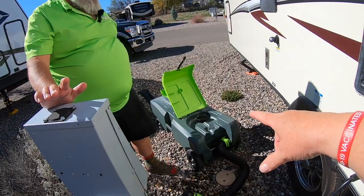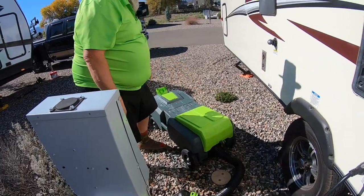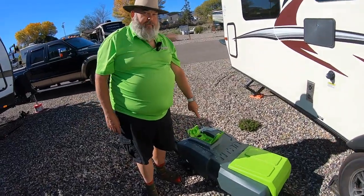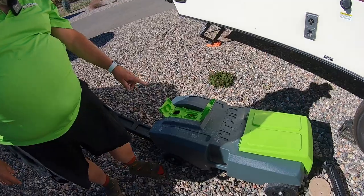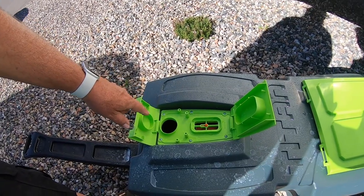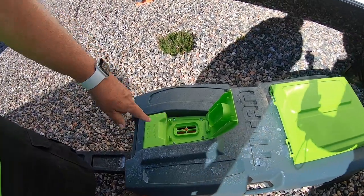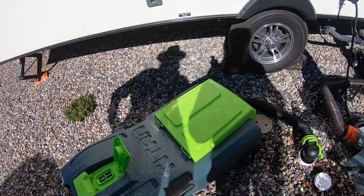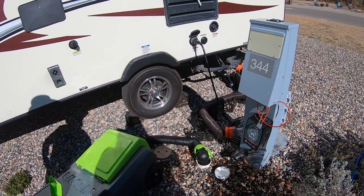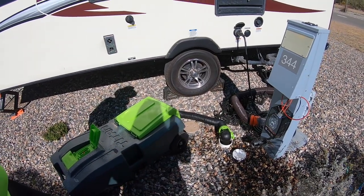So the part we really skipped is attaching that to our actual dump system — you could attach that to the dump system and fill this tank, and then if you don't have an immediate hookup you take this tank to where there is a sewer outlet. Another neat thing: there's this valve that, as you're filling the tote, will eventually pop up. This is also where you can rinse it out with a water hose — like a black tank flush — but when this pops up it'll stop filling so it won't overfill the tank. We have a 30-gallon gray tank and black tank, and this is a 20-gallon tote, so we want that opportunity to not let it completely empty the 30 gallons.